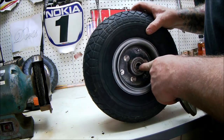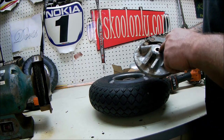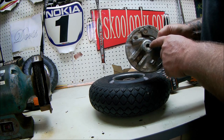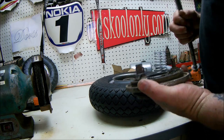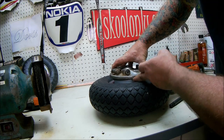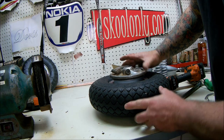These are like a 14.8 millimeter hole. I don't know what that is in Imperial. I don't have a drill bit that size, so I need to take that out to the same size so I can run my axle through. And then all I've got to do then is run another spacer on the inside, so when that's in there, the outer housing isn't rubbing on this. So it just holds it out a little bit, and we'll have brakes.